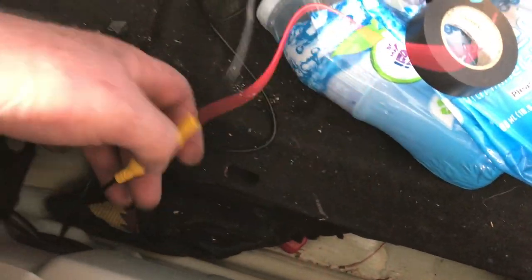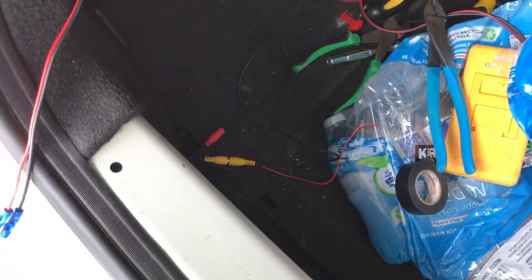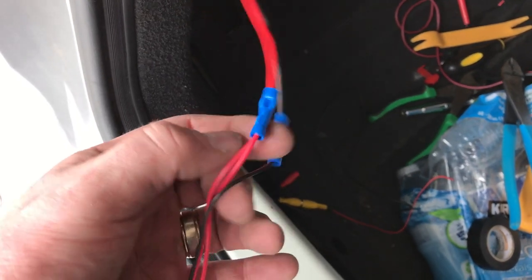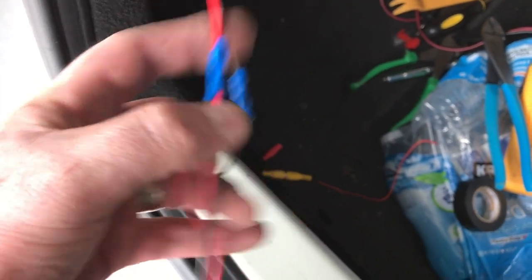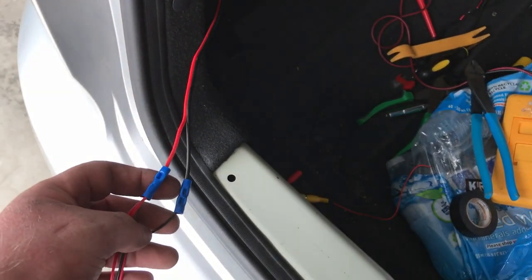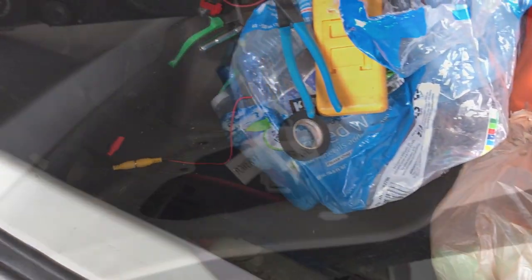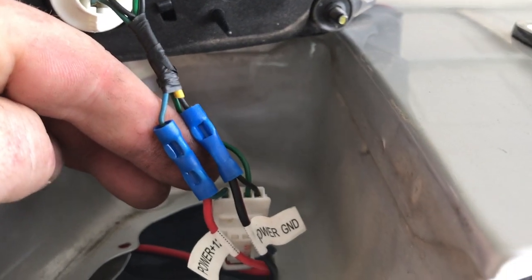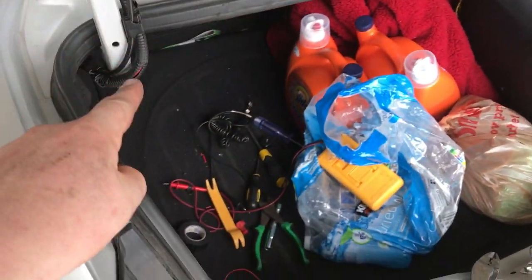Now for that red wire off our video wire — this is going to trigger the radio up front to go into reverse. We need to tap this into the power and ground. What I did is I just cut the line, stripped both ends, and this little extra red wire is going to connect into this red wire — so just the positive. When the reverse light is on, it's powering the camera with power and ground and also putting power to that red wire. I piggybacked on that green wire and then piggybacked on the black wire as well using butt connectors. This will fit right back up inside and the cover goes back on. The loom is all back together.